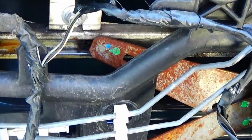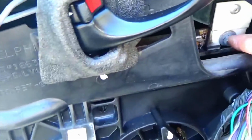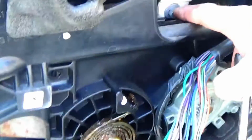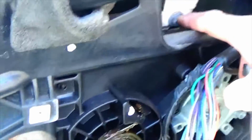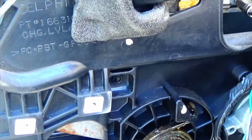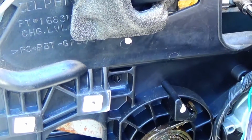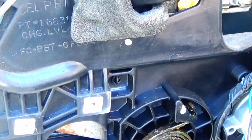And as long as we have the door panel off, I'm going to check the other bolt over here on the front side of the window towards the engine bay and make sure that's tightened down. But I'm going to have to raise the window again. Right, let's make sure this one's snug. That was a little bit loose. Alright.